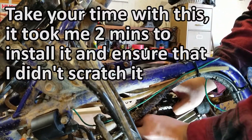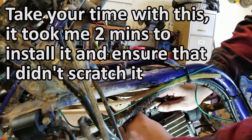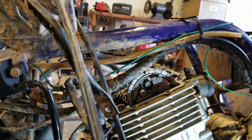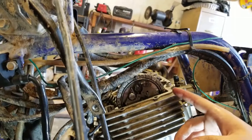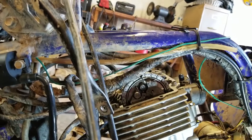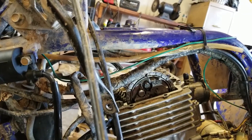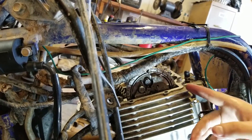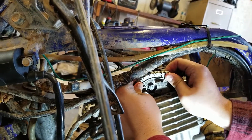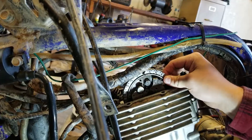It does take a lot of maneuverability to get it to slide down in there just right. Once you get it down in there, you've got to tip the cam upwards just a little bit. Now you want to double check where your punch holes are once you first put it in. I've got one tooth high on this side, but I may have also turned the crank in the process. Make sure you're at top dead center using the eye down there. If you're off, all you've got to do is open the cam up and jiggle the chain around — you can just move it one tooth. Makes it so much easier than what the manual was stating.